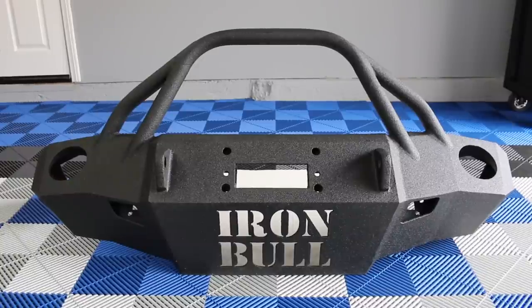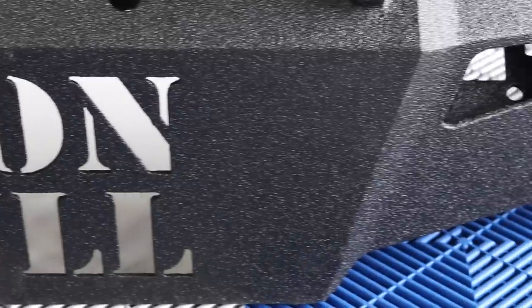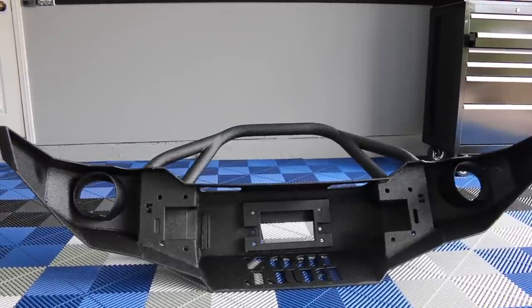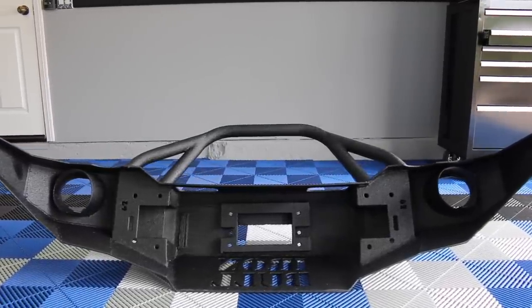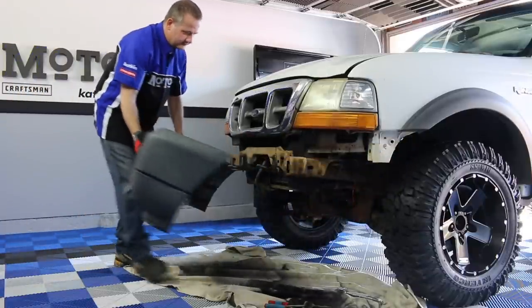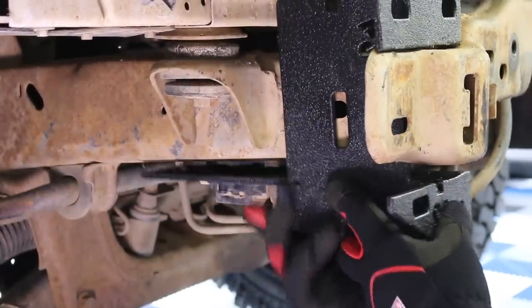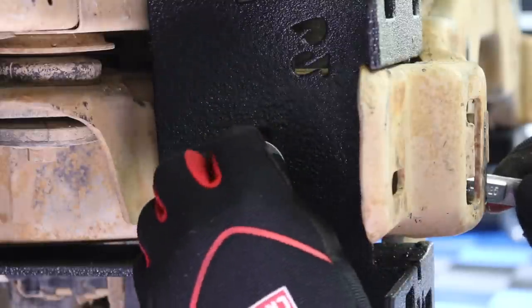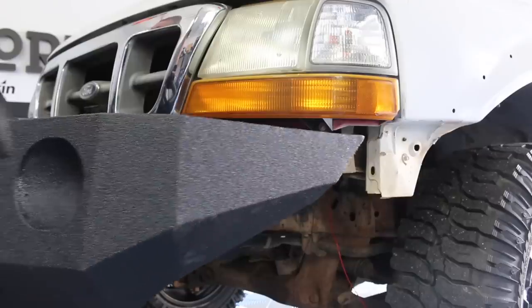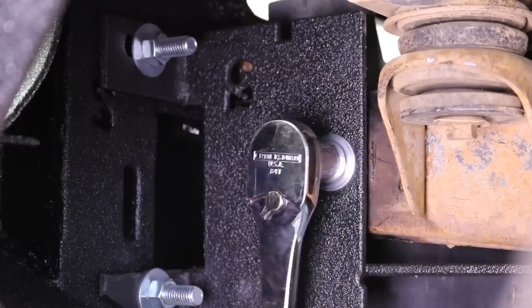After carefully removing all the packing material, I was finally able to see how beefy these things were. Made from the highest grade A36 D-scaled premium 3/16-inch steel, the slightly rubberized black shield coating prevents scratches and dents for years. Not only are there built-in 5-inch light cutouts, but there's a winch mount for the largest winches on the market. I'll soon be installing Pia lights and a super winch to fill those holes. Removing the stock front bumper was really easy — just a few bolts. Iron Bull Bumpers provides all the hardware you need; however, you will need to reuse your factory hardware, so save all those nuts and bolts. After installing the two frame-mounted brackets loosely, mate them with the front bumper, make adjustments for alignment, then tighten all the bolts down.